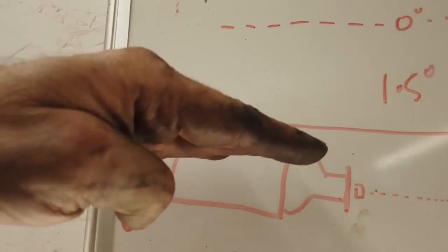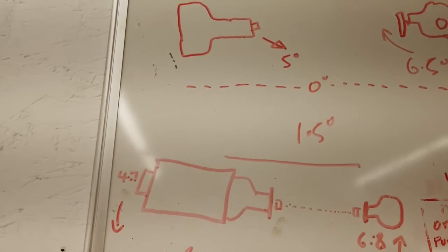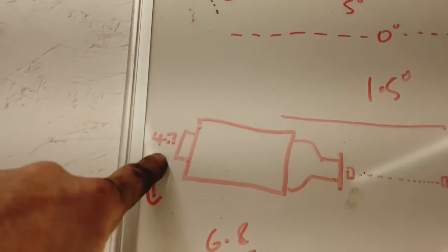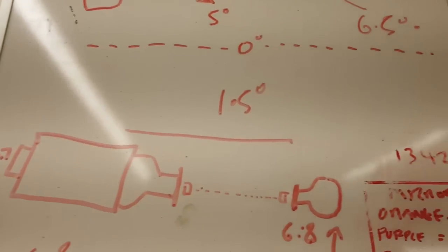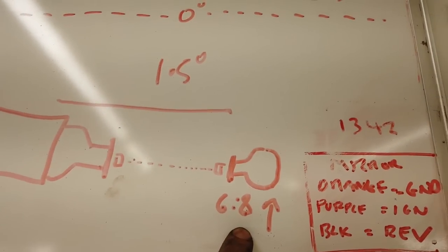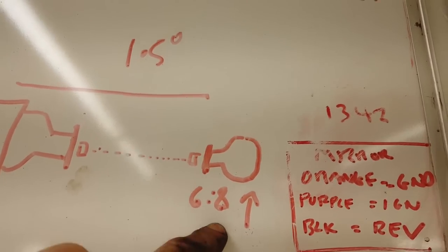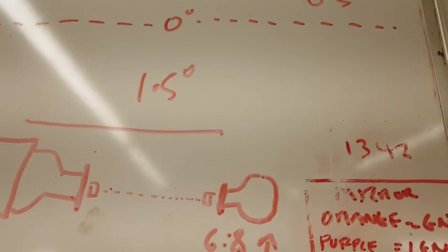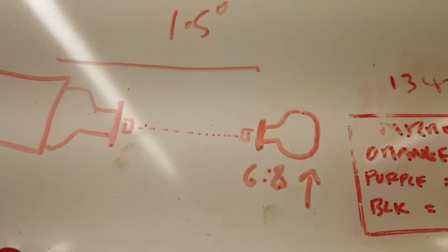But anyway, the engine and your Cortina points downwards. When you have a crash, it sends it underneath the car. There may be other reasons why they point the transmission down as well. You can get your measurement there. In our case, it's 4.7 degrees slope downwards. At the back, currently, or when we mocked up those plates, the axle was sat at 6.8 degrees pointing upwards. And that's the key thing: you don't want them pointing the same way, and I'll explain that in a minute.